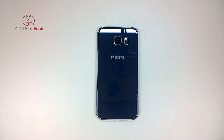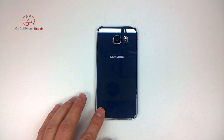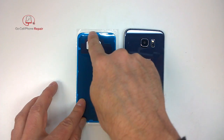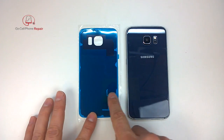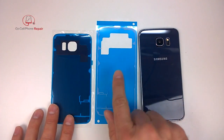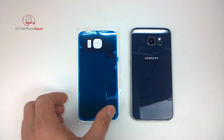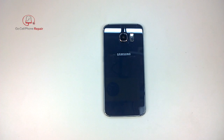When it comes to the rear panel on the Galaxy S6, you have a few choices. Getting this off without damaging any of the paint underneath the panel can be challenging. So if you end up damaging this, you can replace the entire panel. One of the reasons this is so hard to get off is because you have adhesive that goes all the way around. You can replace the adhesive alone if you want to — get the glass off, take off the old adhesive, and replace just that. If you end up damaging the panel, this is also easy to replace, and it's nice when they have pre-installed adhesive. Pick one up just in case; they're relatively inexpensive. But we're going to try to get this off without doing any damage to the adhesive or the glass.